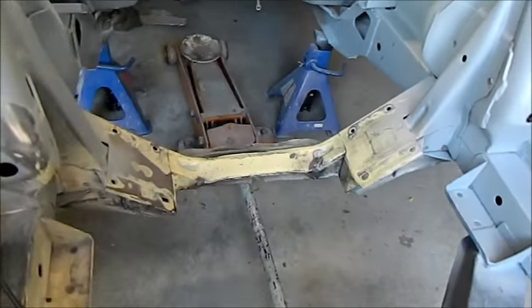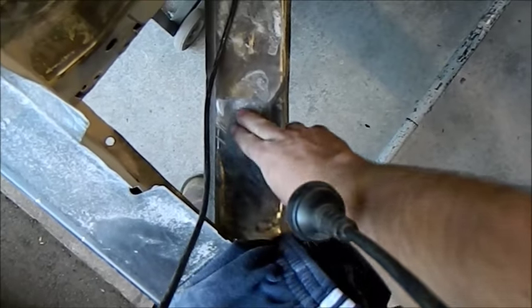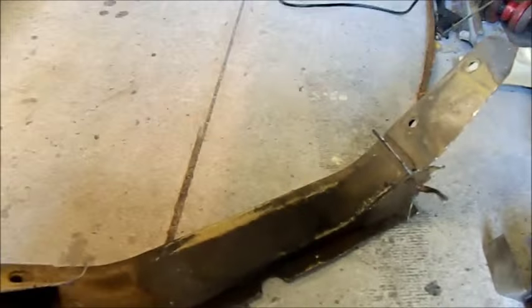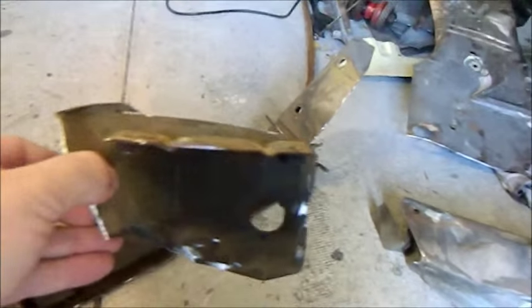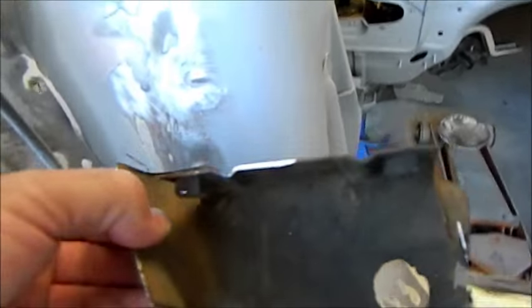Back from Jason's place, I'm going to start tackling this crossmember. There's still a bit of cleaning up to do — this area was all full of bog. I've also got to weld the battery tray bracket onto the shocker tower. The current crossmember needs to be cut out. I've got this lovely one from the donor car. There's a plate I've got to cut out at the bottom — the flat plate — and put the box-type one on that the V8s had.